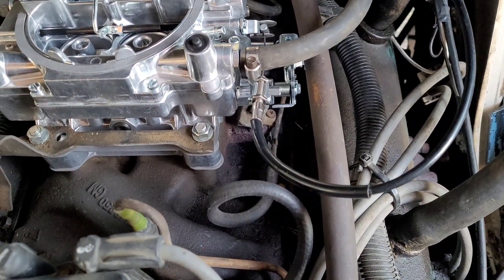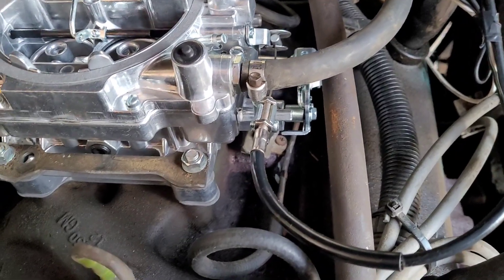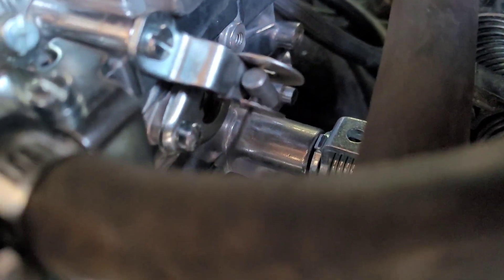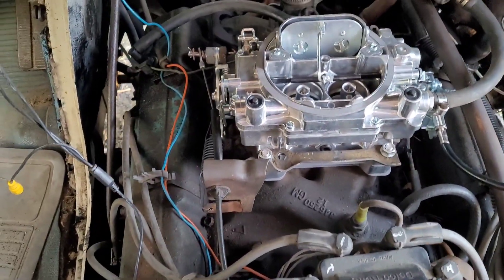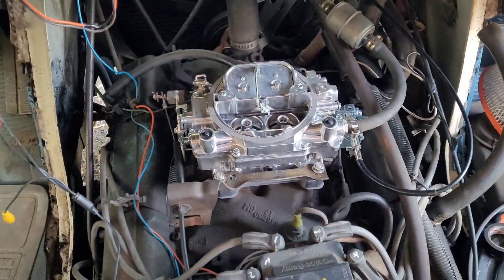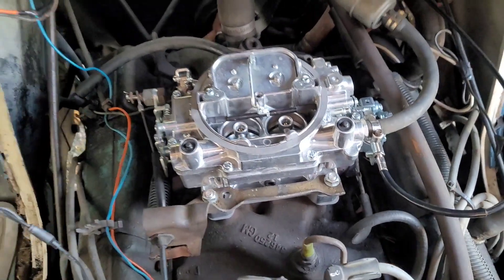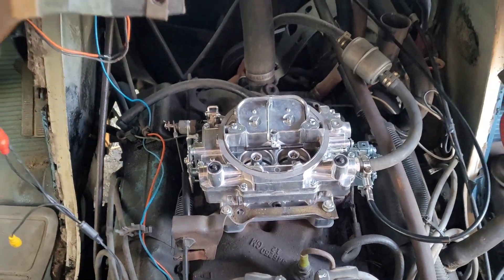It's another day — this has taken longer than expected but I think I've got it done. I figured out that if I put two washers and welded those onto the little bracket, and put a slit in one of them, when I activate the choke everything works the way it should. There's only one thing left to do — try and see if she's going to start. I'm going to fully choke it. The engine is dry and hopefully my battery is strong enough to turn it over long enough for the mechanical fuel pump to do its job.